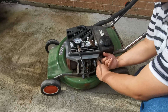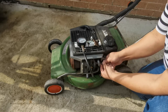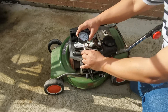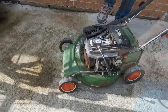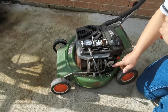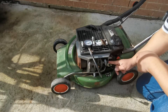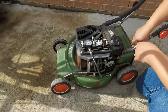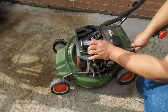We'll try with the hose attached to the restrictor — temporarily plug it and reset. Our reading is still at 60 psi. So as expected, it doesn't make any difference for compression purposes whether we install the hose or not. The hose relates to the carburetor venturi; we'll investigate how it works in a later video. Now let's remove the restrictor and do a compression test again.